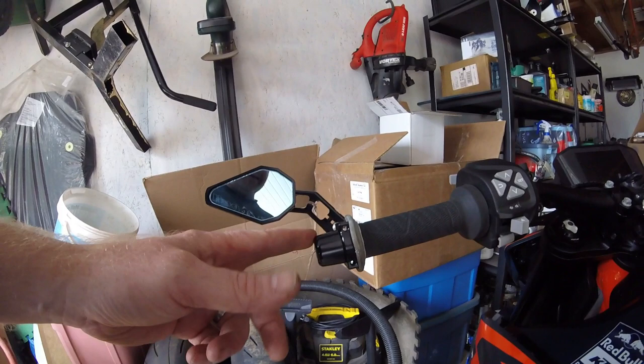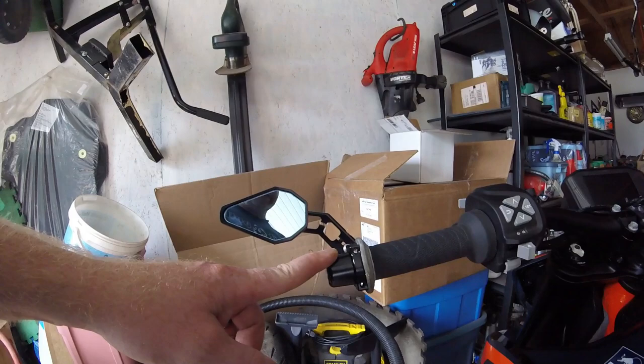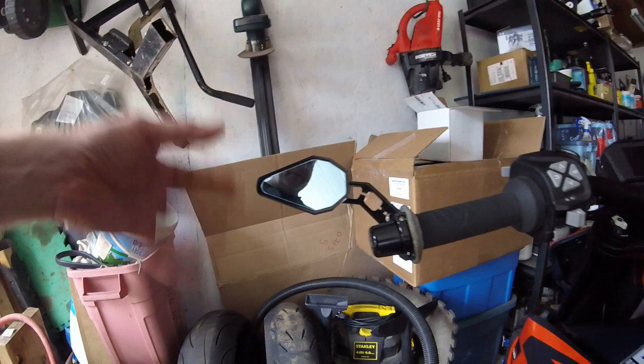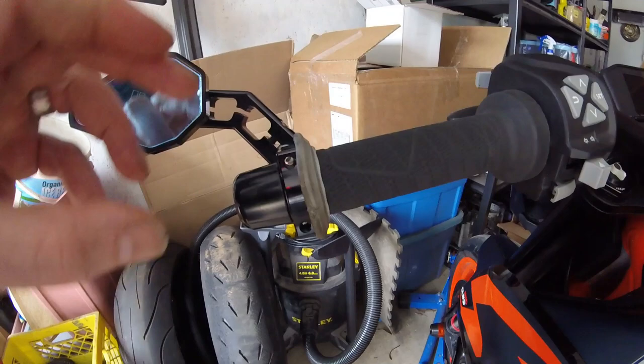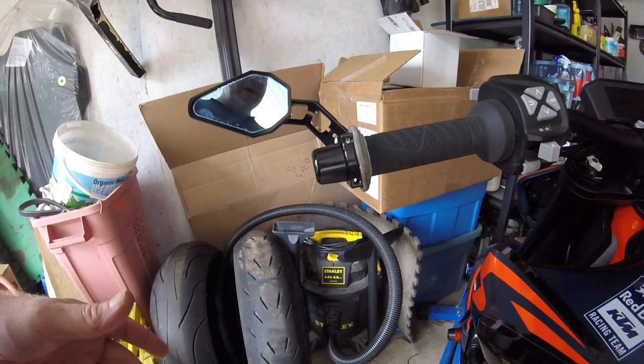There's a Driven end plug specific to this bar ID, but I think they had one left at Fort Nine in Canada and then they were sold out — they were 30 or 40 bucks. What I did, maybe a bit rashly, is trim the edge of the grip so it clamped to the bar as a proof of concept, and it does work. Over the winter I might take it to a machine shop and get them to machine the piece down to 22mm OD, or make a channel in the middle for it to clamp to, and just replace the grip.